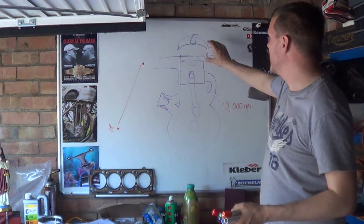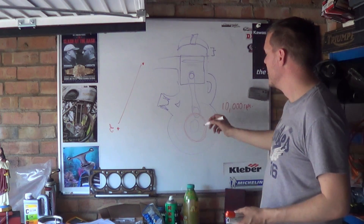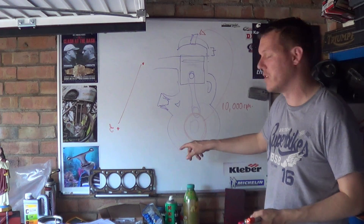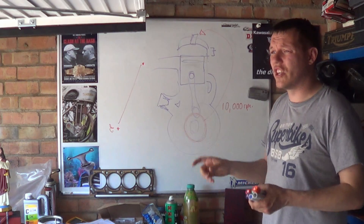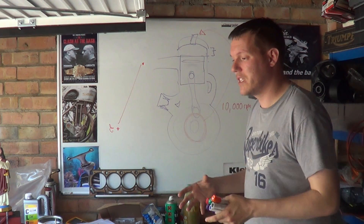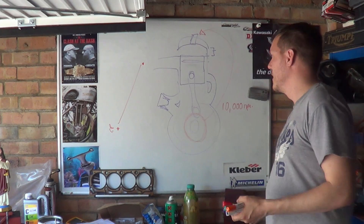The reason why it's so hard is because you need to power an injector. You can power it with batteries, but the batteries get their energy from the engine - you can't get energy from nowhere. So you put a magneto, a generator, an alternator, or something like that to power your electric solenoid or voice coil. This has to produce a shitload of energy - usually quite a big current, around 48 volts or something like that - to run a high-pressure electric pump. The solenoid in the injector has to be more beefy because of the higher pressures. So all of a sudden you're pulling a lot of energy out of this system, especially for something like a 250. The weight of your alternator to be able to do this then makes the whole point of having a two-stroke pointless.